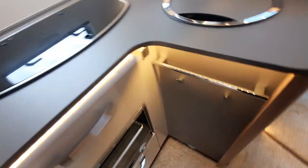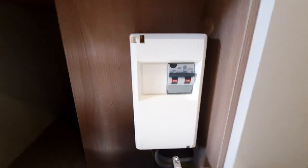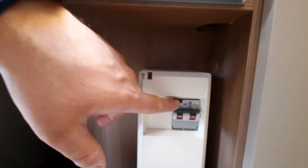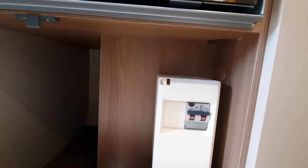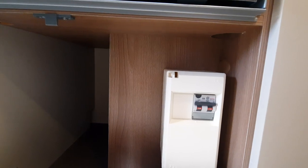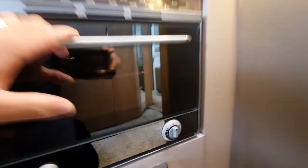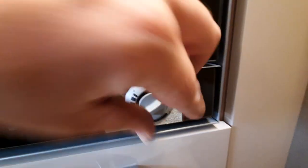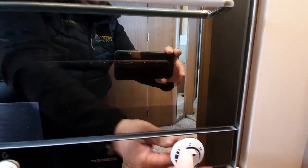There is storage there, and in the kitchen area you've got your utensils. You've also got a push button here which releases the larder that pulls out — a good storage area for bottles or larger items. A couple of hooks and a towel rail there as well. Underneath that there is access to the RCD — this is like your main RCD breaker at home. There's a test button on the top: if you don't think you're getting power to the vehicle, press that button and if you're hooked up to mains it will drop the breaker down. If you press it and nothing happens, there's something wrong with the feed coming to the vehicle — check your mains cable or the post you're plugged into. Above that we've got your oven and your grill — clearly marked. Make sure you open the door before use, press it in and you'll hear the igniter. There's a light button to see what's happening inside, and the middle position is just off.